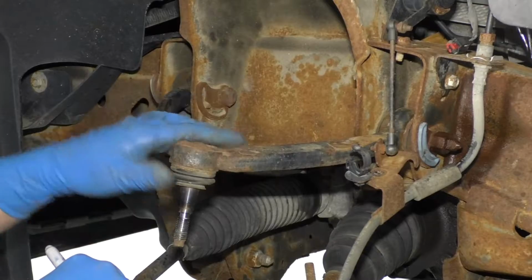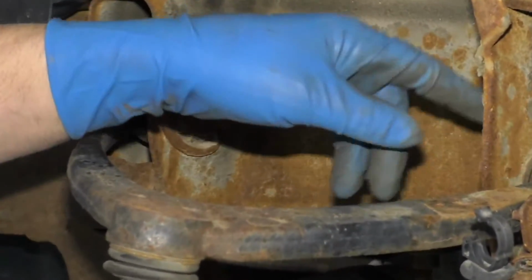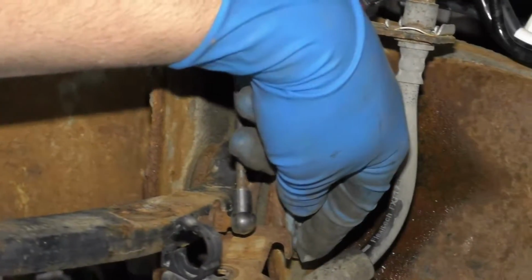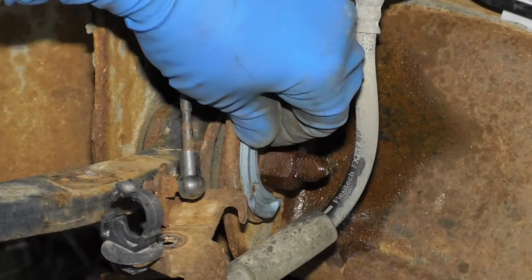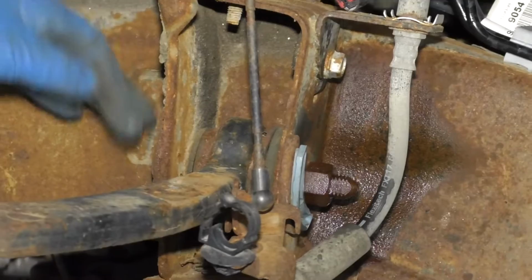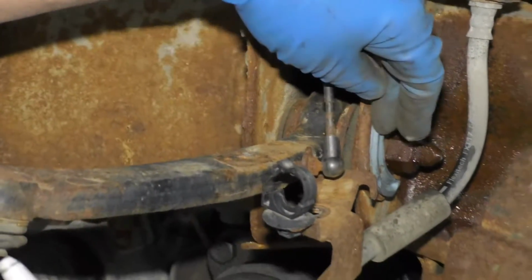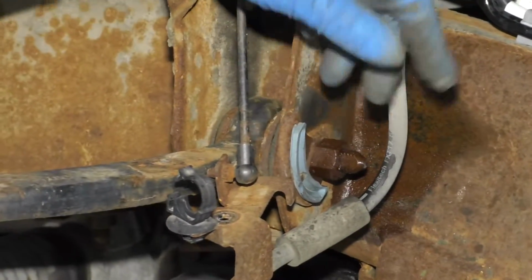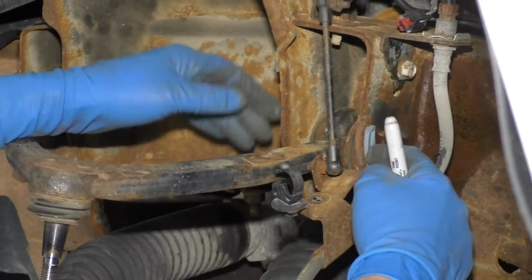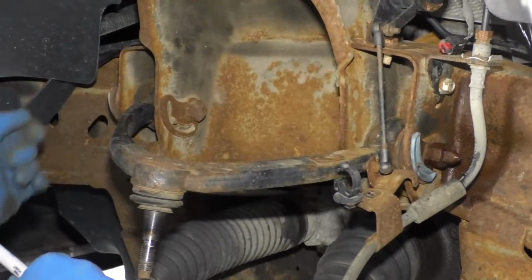Before we take this upper arm out, we want to pay attention to the alignment cams that are on the top. Now these actually have these plastic little inserts in. They're basically like knockouts. The older vehicles had something called knockouts, which you actually had to take and hammer out. These ones just have these plastic little pieces. So in the factory, when they put this vehicle together, they use those and that aligns this where it needs to be. So if you have those, then you're good.